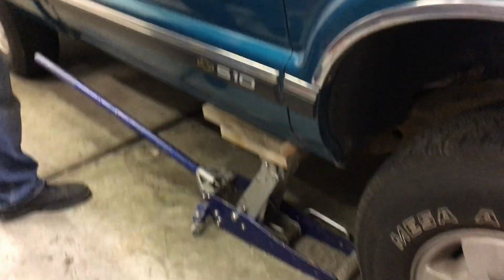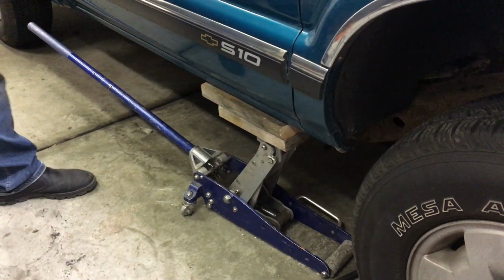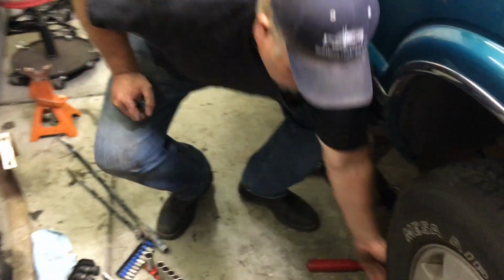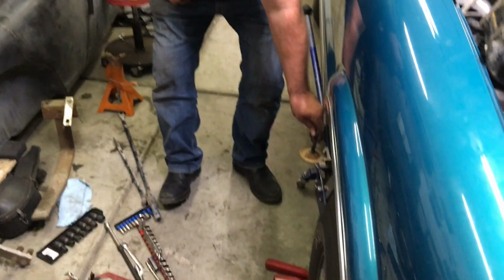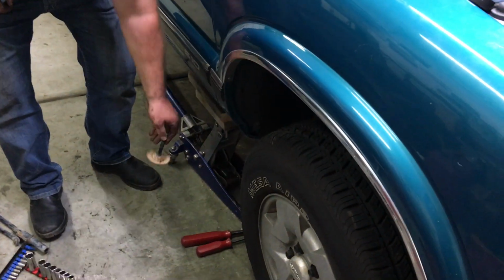As you can see, I still have it. We barely pulled this out, so I still have it jacked up. So what you do, you undo your two front radiator bolts. They're like a body bolt on the front radiator support. They're actually nuts on the radiator. Undo the nuts, pull them off, and remove the body mount from the front body mounts, which are right there.